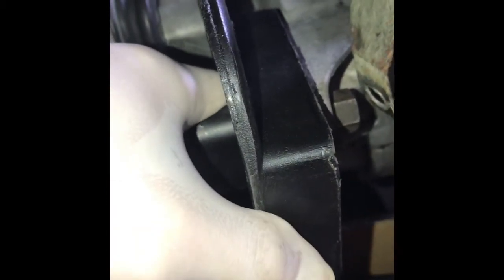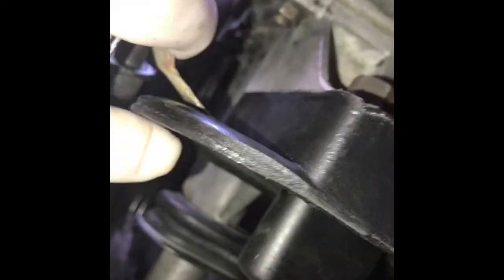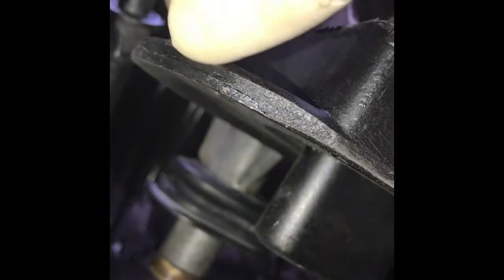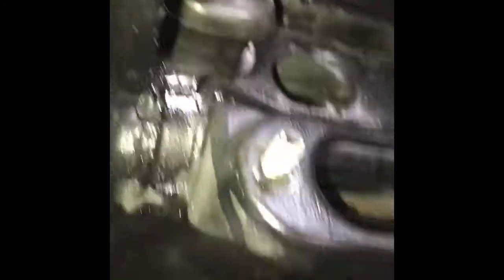This is the replacement mount for the OEM one — it's just snugged in right now. Next I'm going to roll the transmission down to connect it here, and then I'll put the ground strap in front of the support. The ground strap will connect right here — the stud will stick through there with a nut, and we should have our transmission grounded.